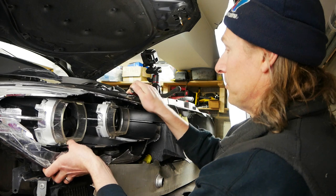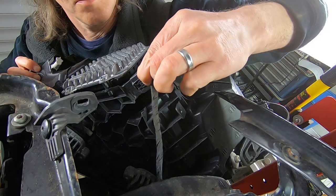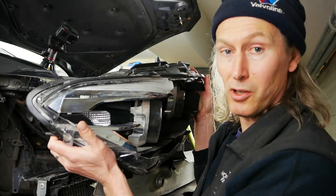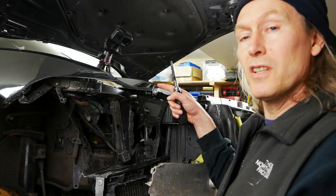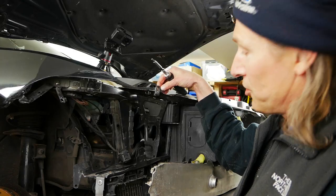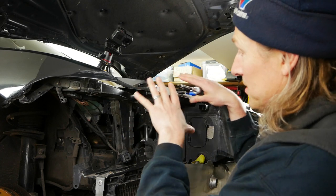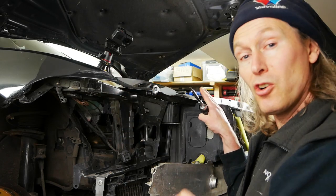That's the last one - this should just lift up and out now. As I expected there's just one electrical connector at the back to undo, and there we go - one absolutely mullered headlight removed. It's worth showing this for future reference: this is the bracket I just undid here, and it slides in and out. You just tighten it up in the position you want it, and that will allow you to set the position of the headlight relative to the bonnet and the wing to get that line correct.